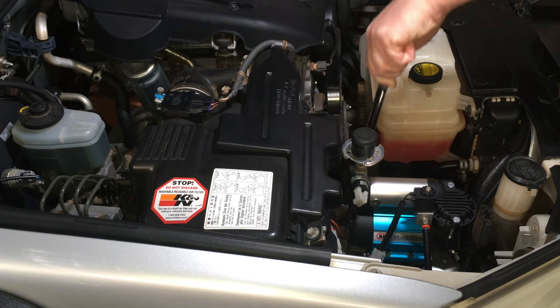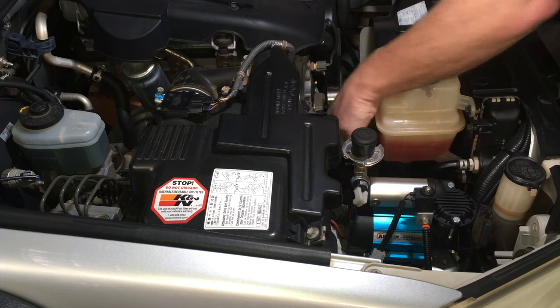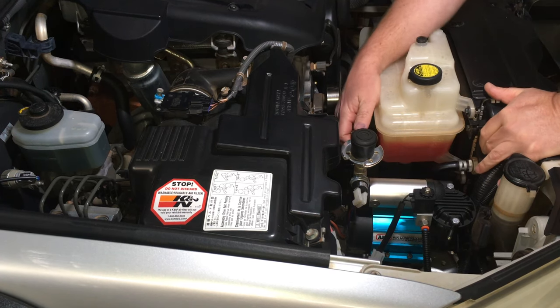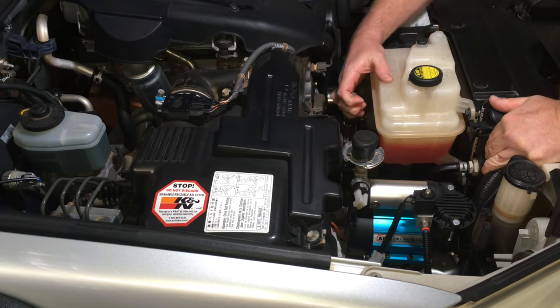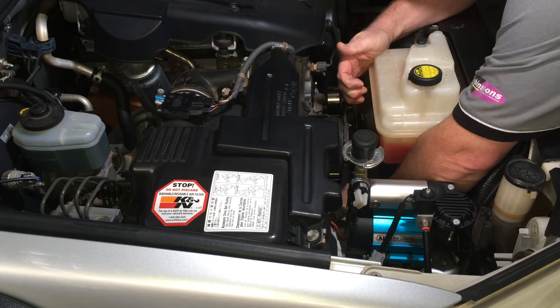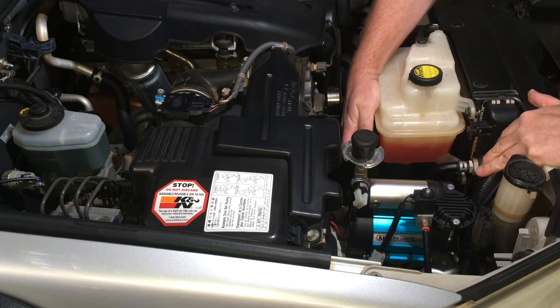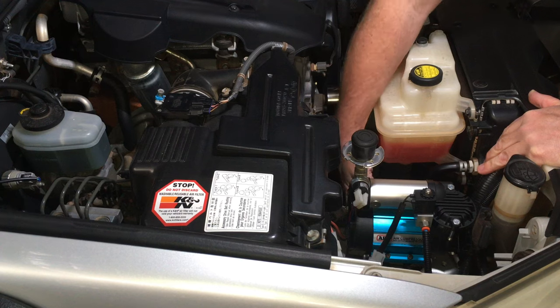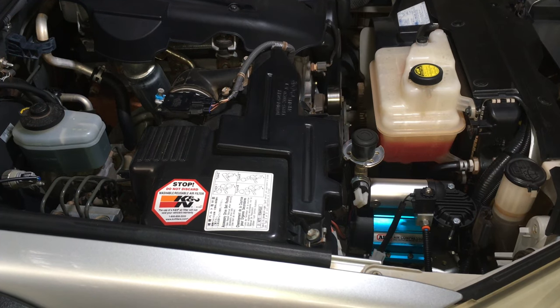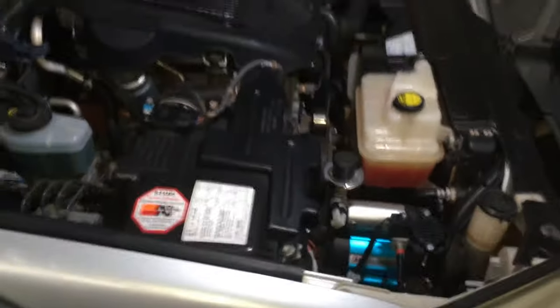All right, you get the tool. This is taking the tension off the drive belt. It's as simple as hook that breaker bar on, pull it up like that, right? Then hook the belt off, right? So the belt's off now. Release that, right? So the belt's off, you go change your alternator, whatever you want to have a look, right? I'll just show you, get you in there and give you a good look, right? So you can see the belt's off, right? Sit tight and we'll get the belt back on again.